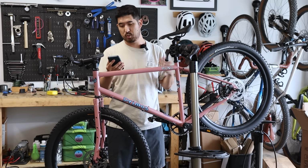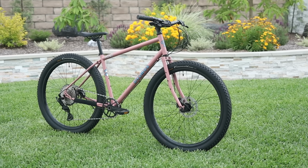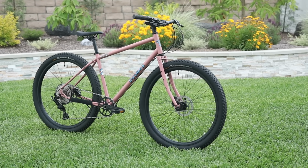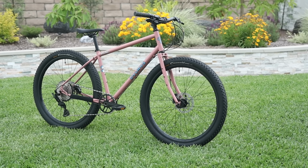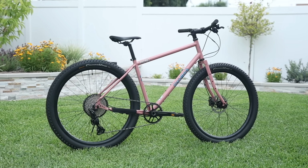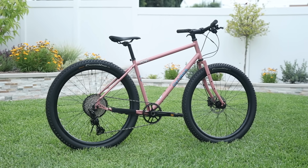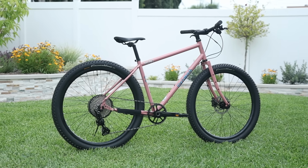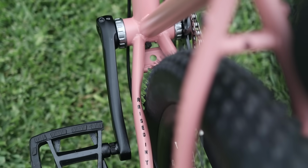According to Primos, and I quote, "The Mono is our back to basics bike, inspired by the days of beat up MTBs and zero suspension. We started with the flat bar concept, but it naturally evolved into something else, bike packing ready, off-road capable, and just fun." Geometry-wise, it's playful but grounded, so you have longest trail at around 70 millimeters for a nice stable descender. You also have pretty long chainstays at 445 millimeters. It claims that it has room for 2.2 inch wide tires, but again, just looking at it, if you really wanted to, you can definitely put like a 2.4 in here.